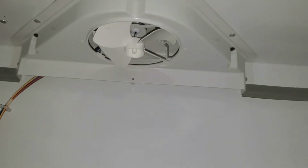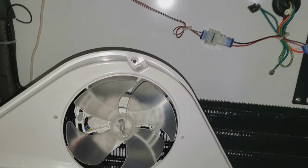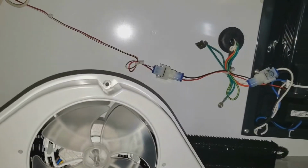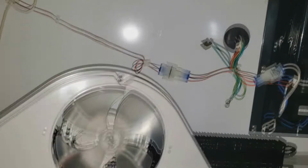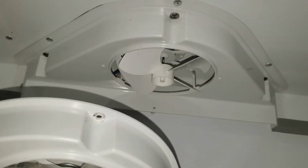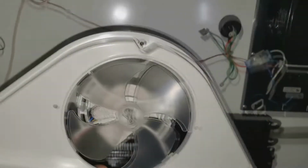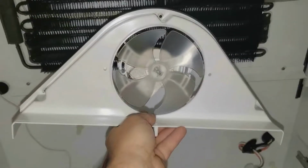Lots of times when you look up evaporator fans, you'll see revision used with black. If you have the white fan blade, you need to get the black fan blade, or the clear, and there's all kinds of descriptions about the color of the fan blade. So the color of that fan blade and the configuration of the bend and the way that it's configured does mean something with these Sub-Zero refrigerators. So don't leave this fan in. It's not going to work if you do.